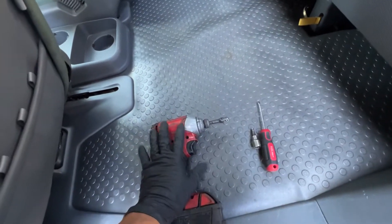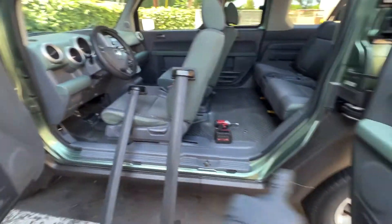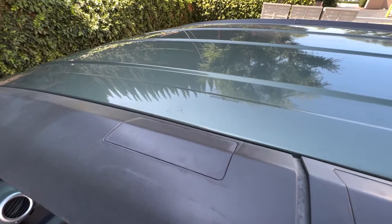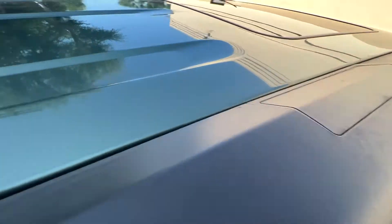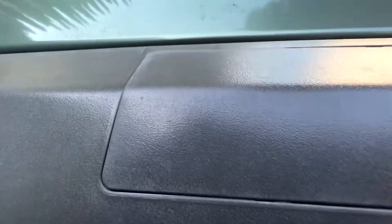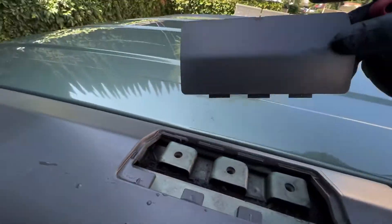I'm using an impact gun but I highly recommend you just go with a ratchet. What you guys are going to do is open both of the doors — you can use that to get up on this side, then come up on the roof rack. You guys are going to see this is the driver's side and there are three covers: one over there, two, and three. We are going to use this one right here and that one over there. There is a groove right here — that's where you are going to insert the screwdriver. There are actually three grooves so you can use all of them to lift this plastic up, and then it should pop up.